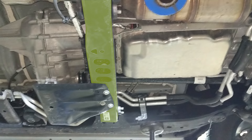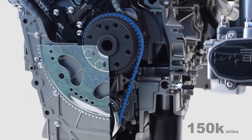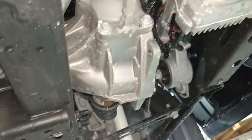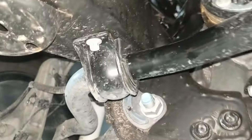Here I'm showing you that the crossmember comes out easily to drop or pull back the transmission, which is important because at 150,000 miles this vehicle has a wet belt oil pump drive belt that has to be replaced. That's the minimum interval — they say it could go longer — but you have to pull the transmission back to do it. You're probably looking at a significant dealer labor cost if you have them service that, but the transmission does come out easily on its own.